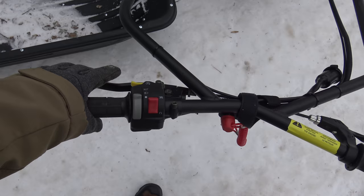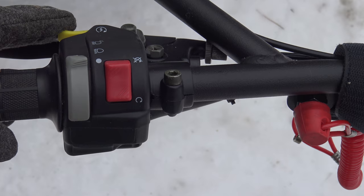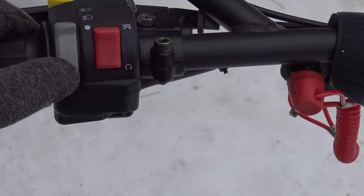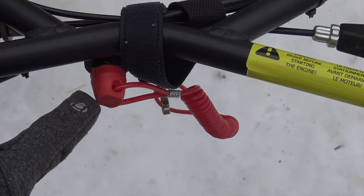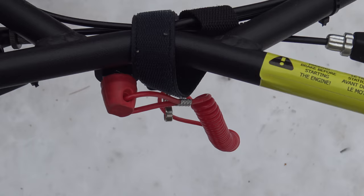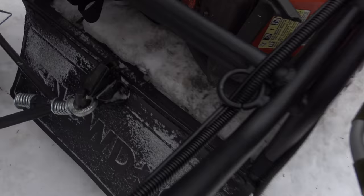The handlebar folds up and down so you can carry it in the back of a pickup. You've got your brake lever, your switches, headlight switch — two-stage dims and highs — and a yellow starter switch. There's a kill switch in red, and I've got hand warmers that cover it up, which makes it a little confusing; you need to know the controls well. The tethered kill switch — when I was skidding logs, I'd push against it and it would often come disconnected, which was frustrating. When you let off the throttle, the machine stops right away. There's also a little 12-volt socket — possibly for an optional hand warmer, or you could charge your phone.